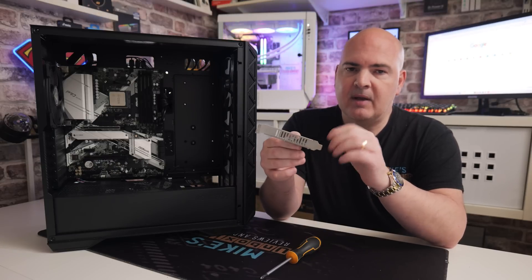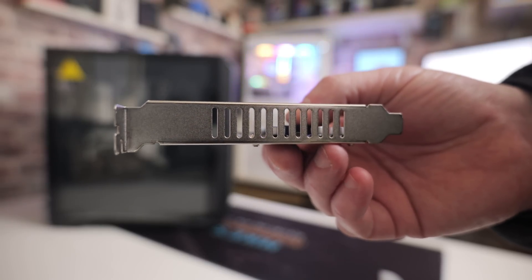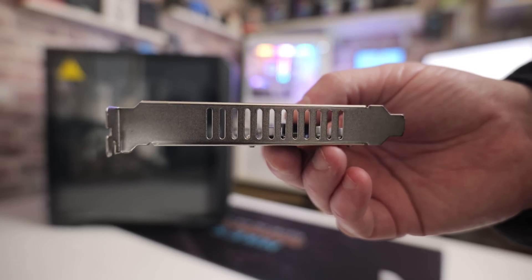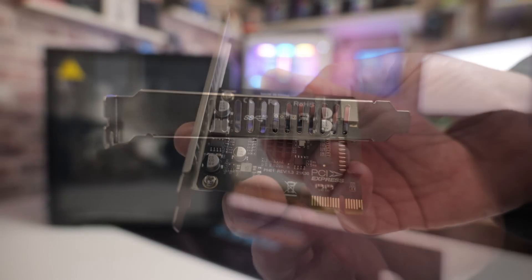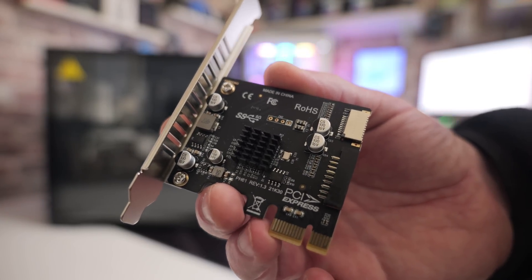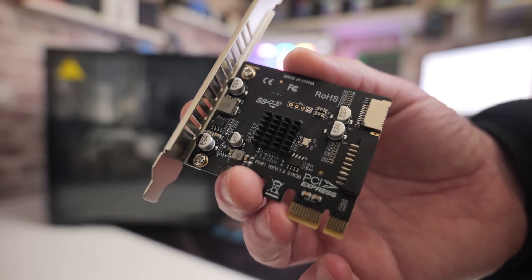Another downside of this, other than it being slightly slower, is the fact that the backplate is actually kind of like a sparkly chrome, which doesn't always fit in nicely to blacked-out builds. But don't worry, it's pretty easy to remedy that — it's only held on with two screws, so you can undo those and give that plate a little coat of paint. Get yourself a rattle can, some matte black or satin matte black paint, or even some enamel-type paint. Once it's dried, you can attach it back on and it won't affect performance at all and potentially it will look a lot nicer.